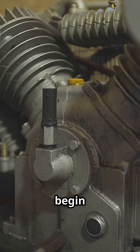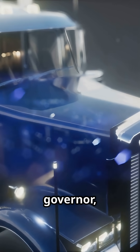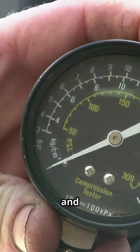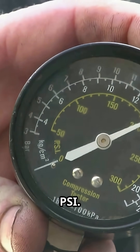A Class 8 tractor's air brakes begin at the engine-driven compressor. Compressed air is regulated by the governor, building system pressure. It passes through the air dryer to remove moisture, then purges. Primary and secondary reservoirs fill to a normal 90 to 120 PSI.